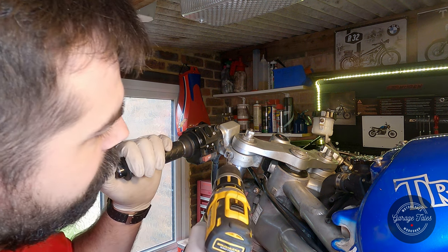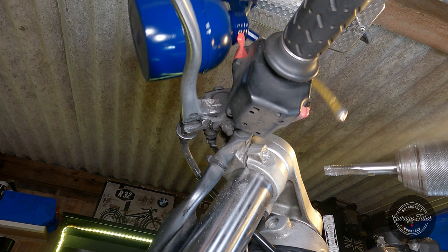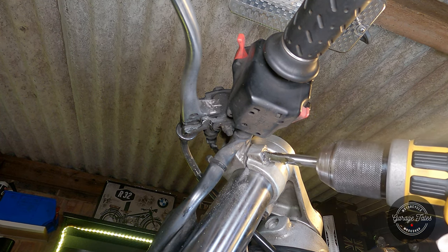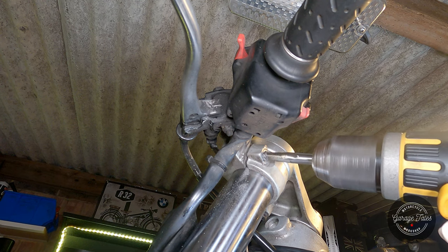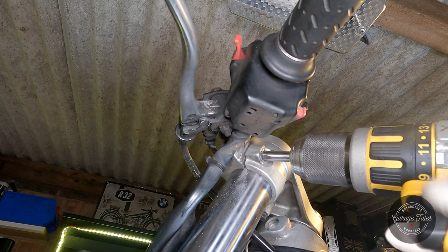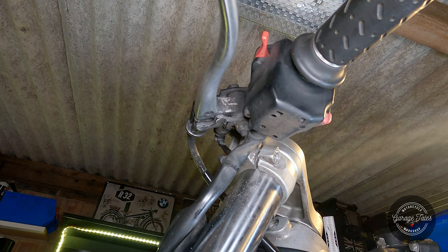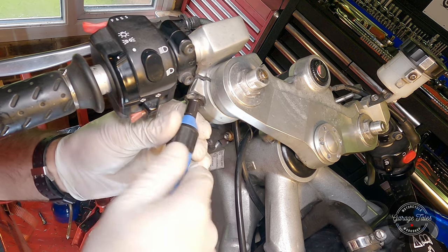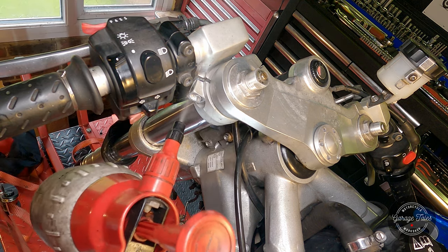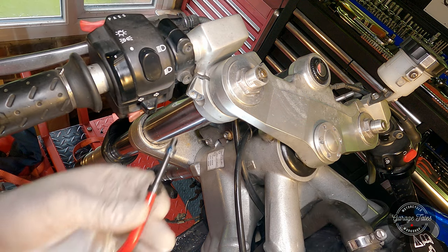There's no point in wasting any more time, I'm just gonna go ahead and helicoil that thread. I'm gonna start by drilling a pilot hole through and cutting the threads. I feel like a bit of a savage doing it with a drill, but maybe I am one. What's missing from here - because I forgot to press record again - is that I used a bigger drill to make a clearance hole through the first half of the handlebar, because that doesn't need to be threaded. I've also used the tap again to make the threads just a bit deeper. Now I'm gonna clean everything up to make sure the Loctite sticks to it, then apply some thread locker to the insert and put it in and thread it all the way.